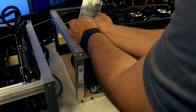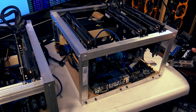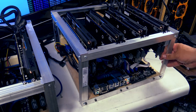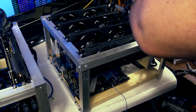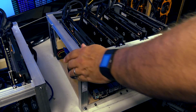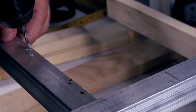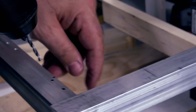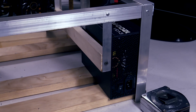We went with a completely different layout for the motherboard and power supply - this rig is 16 by 16 by 11 inches tall, accommodating four large 390 cards well. The tower strut holding the graphics cards up lets us flip it so the power supply tucks toward the back upright with the fan exhausting out the rear. The riveted build comes out much cleaner, though it adds about 15 to 20 minutes to the build process. Drop us a comment below if you'd like to see a live show walking through this rivet build.